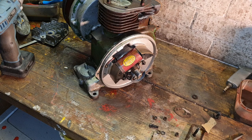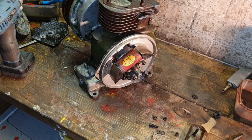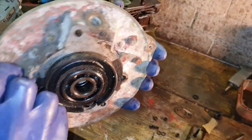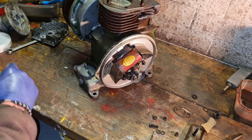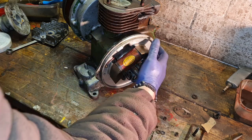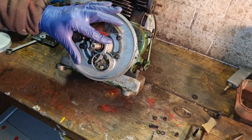I think we've got an old Villiers here, which probably... hang about. I know. There's an old back plate here. Here it is. I'm fumbling. Oh, it's a Villiers back plate, but that one's broken off as well, look. I think we can buy them new. So we don't bother about that for a minute, because that will screw in without having to have the flywheel off again. So we'll time it up, put this flywheel back on.